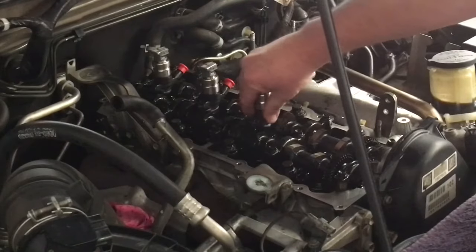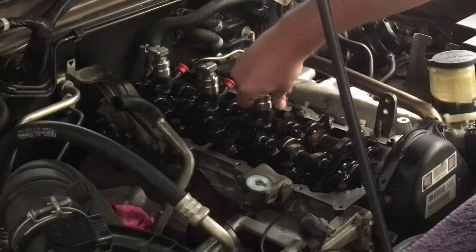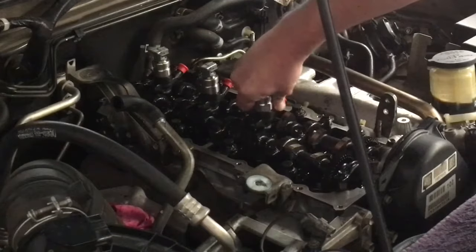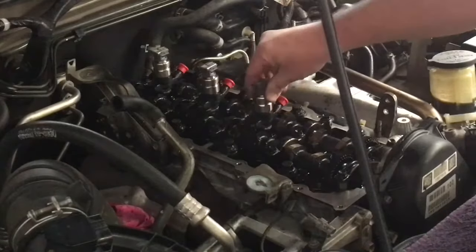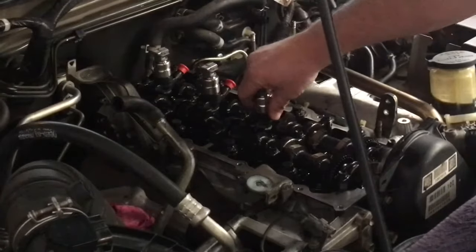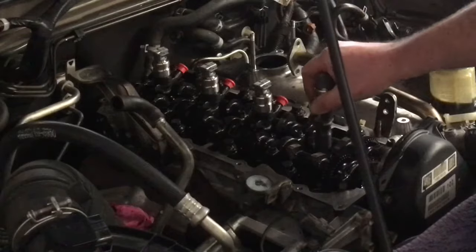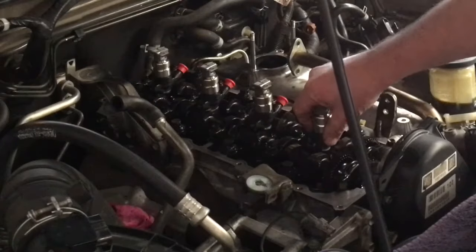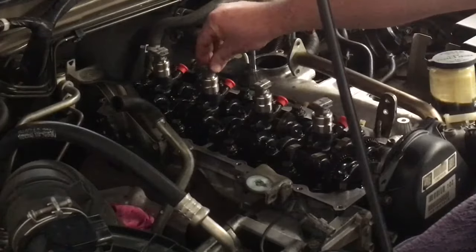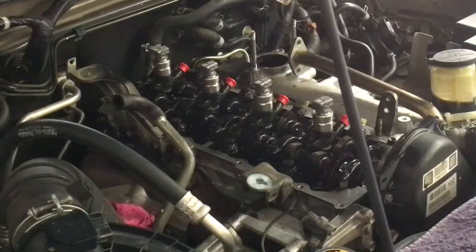Sometimes, because they're a bit tighter now, the actual injector itself can be tight. It's not necessarily the O-ring. So just a bit of a gentle push, always twisting. It's all lubricated. As I said, they've made them a bit tighter. See how that one, the heads vary as well. Some of these used to be really sloppy, but a lot of them are a tighter fit now. Obviously they had to allow for the worst case scenario with the sizing of the port. So when they made them bigger, see that one has a bit of movement, as does this one, and that one even less, but this one's the tight one. They've probably gone up to a size that allows for the tightest port, if you know what I mean.